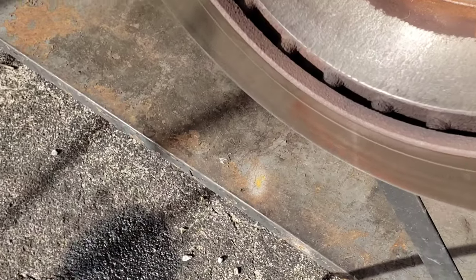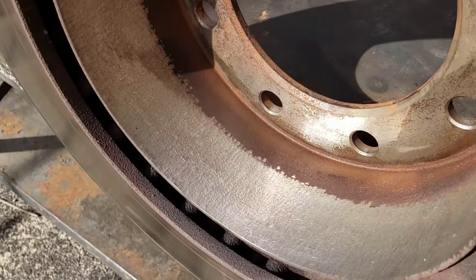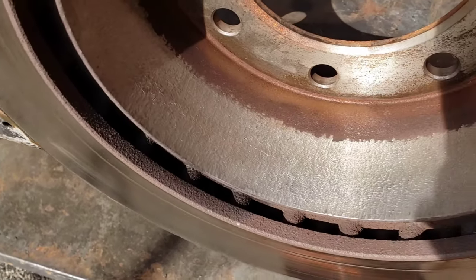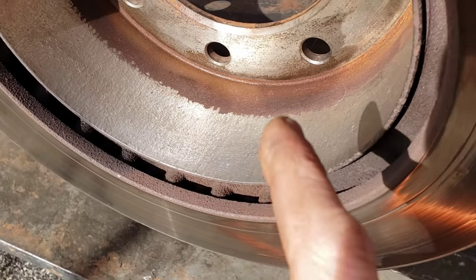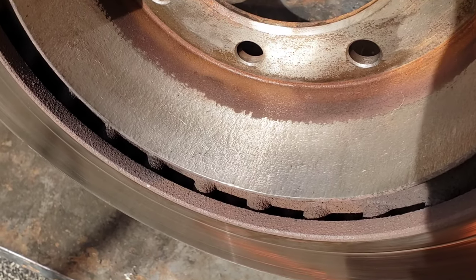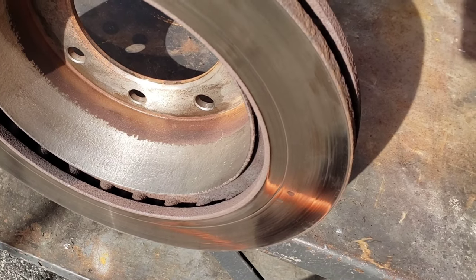Here's my finished result. I've gone around the entire drum on the inside and now have a very light texture to it, with the idea to increase the stopping power of the parking brake on my manual trans. It feels nice — not jagged anywhere, just textured just a little bit to roughen it up. So let's get it installed and go from there.